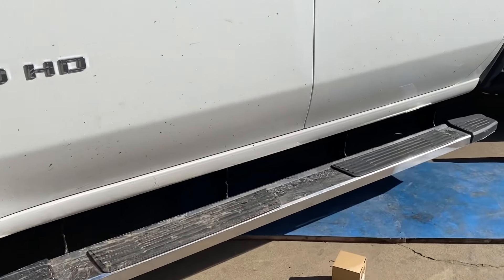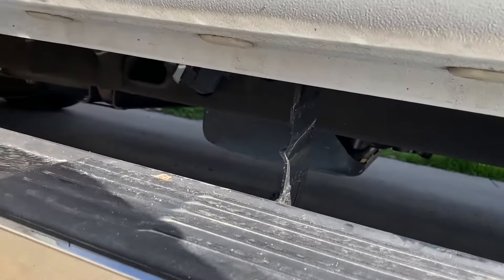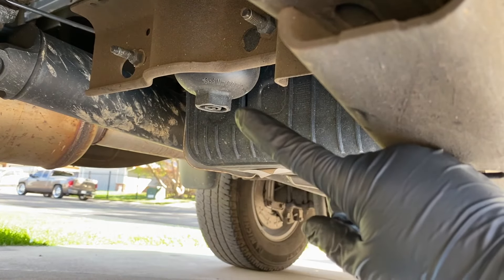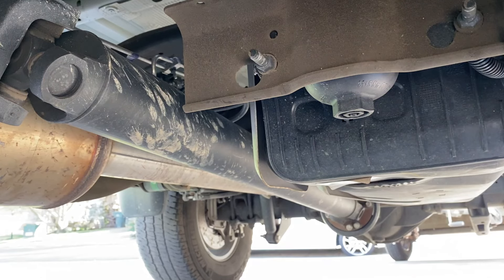Your fuel filter will be located right in front of your gas tank. On this side is the diesel fuel tank, and we go right under the truck here. Here we have the fuel tank, and here is the fuel filter. You're going to need a 1 and 7/16 tool and something to catch the extra diesel, because when you take it off a little bit will be spilling. Make sure you put that right under there.